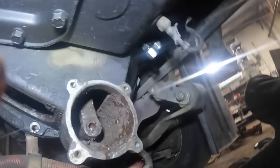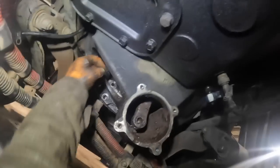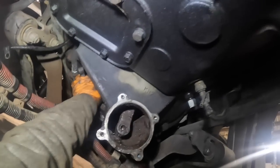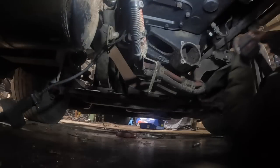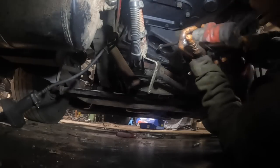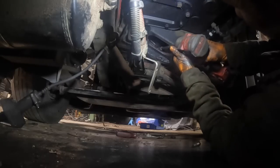And some guy on one of my videos, I had said something about doing a clutch like this, and he went through an elaborate comment about two paragraphs long telling me that I was full of shit, that there was no way you could do this. What you do is you stack your whole clutch up on the input shaft, and you use the transmission jack as a clutch jack as well, and then you stick the damn thing in there, and then you just rotate it around and put your pressure plate bolts in.